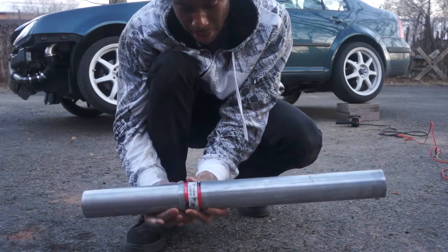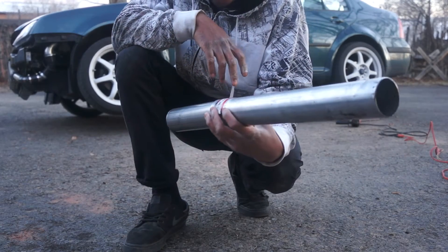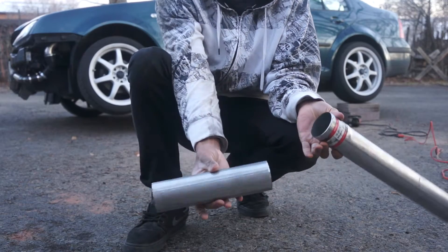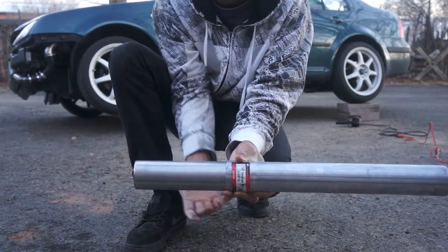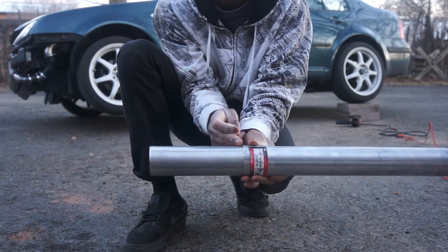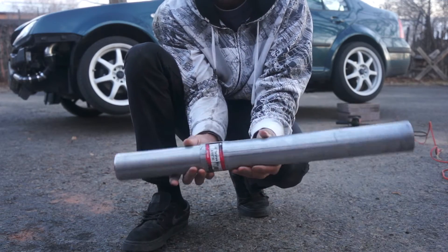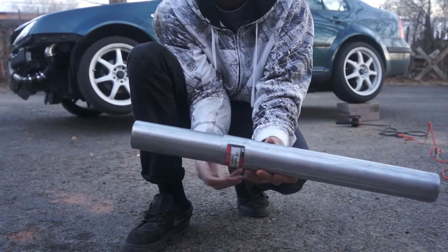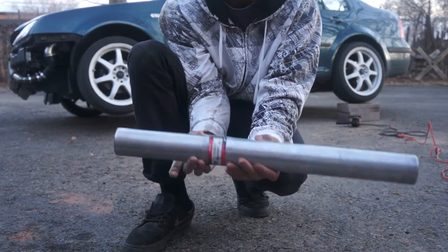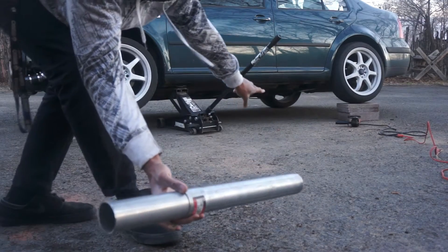So this is the piping that I want to use. It's two and a half inch. This is just an 18 inch tailpipe extension plus this piece. And then I'll just tack this one inside — tack it on the ends and then at some point go weld it all the way around. It should seal up just fine. I don't care about an exhaust leak this far outside the exhaust. So that is the piece I'm going to be adding into the bottom of the car over there.